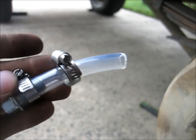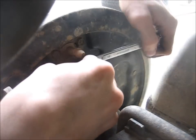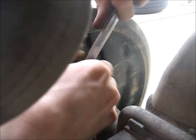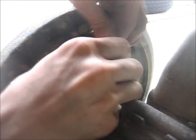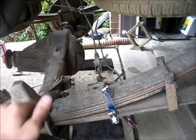I've got this funky-looking thing in my hand — a piece of hose with two hose clamps and a bolt. My idea is: when I disconnect the brake lines, I'll slide this over the end of the brake line, clamp it down, and hopefully I won't lose too much fluid. This doesn't do anything about fluid coming in between the line and the inside of the nut, but hopefully it will prevent me from having to bleed the brakes with a dry system. Got myself a flare wrench. I already took a toothbrush and cleaned off around the fitting so I don't get any dirt in my brake system. Looks like it works — now I'll just do the same thing on the other side. I've moved that brake line around now; it's resting on top of the springs instead of underneath.